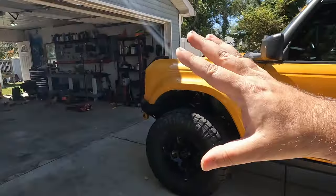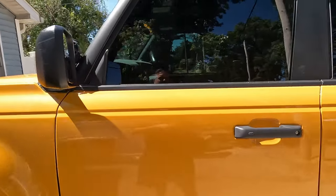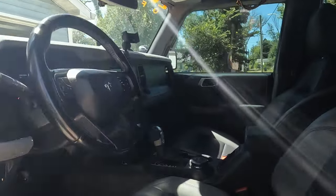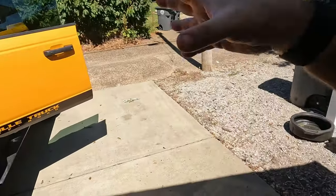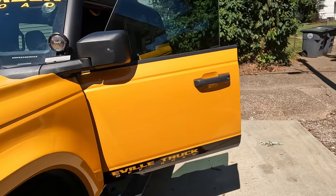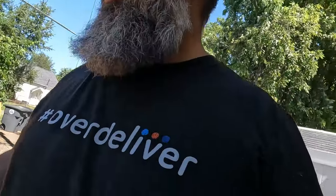I mentioned there was a bad smell. I did get the rear end lowered so I can get the Bronco in the garage. Leaving the windows open overnight for a couple of nights got rid of most of the smell. There was still a bit of a lingering smell, so I used this Meguiar's Whole Car Air Freshener Odor Eliminator. You turn your air conditioning on with the vents on so all the air is blowing through, set that off, close the doors, let it circulate, then open the car and let it ventilate for 10 to 15 minutes before you get back in.